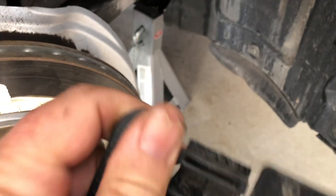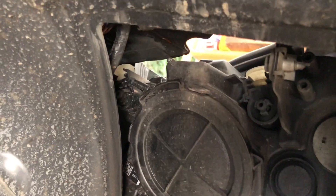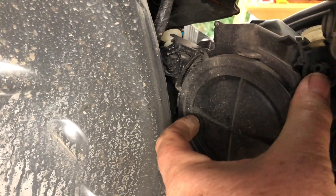I'll pull it out so you can see it. It just slides in place at the bottom and these latches here you just have to press them down to get them out. I had to use a couple of screwdrivers - it was a little bit tight to get out. But when that panel's out you see another one of those headlight fittings. You also see daylight straight through there. So again anti-clockwise around like that - take that out.